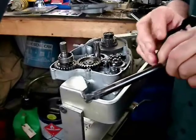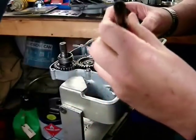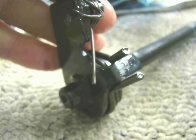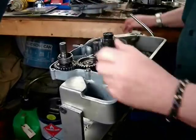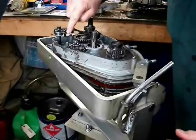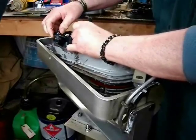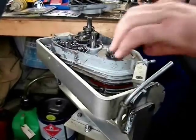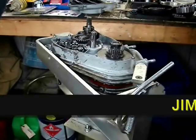Now the shifting shaft mechanism — making sure all the pieces are correctly assembled and the two little claw tips on the shaft are nice and sharp. The two little feet on the spring slide down over the post between the shaft and drum. You have to pull back that spring-loaded arm, the claw, and make sure that spring sits over the little post correctly. That claw will sit down over the six posts on the drum — that's what shifts the drum through the gears. Now we put the big thick washer on the primary shaft and put together the main clutch hub with the center bushing and two needle bearings.